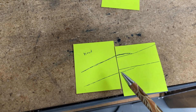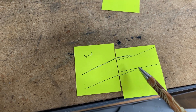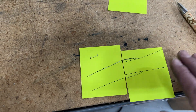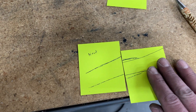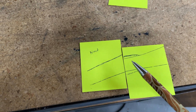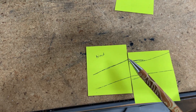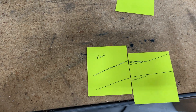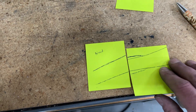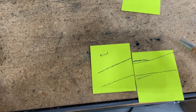At least you're making a transition, but you want to put the step there so you'll have to bring it further in. Sometimes there's not enough material either here or here to do that. Me personally, I like to have it more towards the lower side — if I can have it where the manifold floor is touching, because it's far easier than the top. I'd rather have it where the floor lines up than the roof, because I can for sure weld material here. It's much harder to weld underneath the intake.